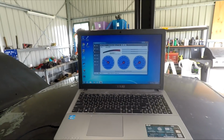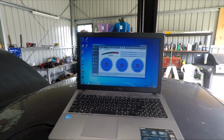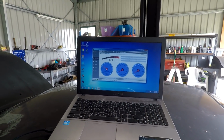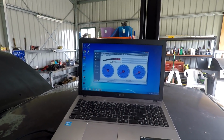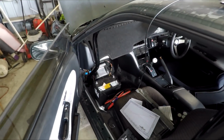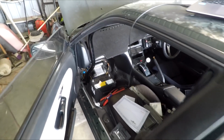Now, if you look at the 4L60 gearbox, there's two solenoids, solenoid A and B. When both solenoids are open circuit, that's third gear. So if you've got no power to the gearbox, it'll show third and third only. It's kind of like a fail-safe, so you can still get home, and you can manually select second. I'm guessing so you can take off up a hill or something like that. I don't have any power going to the gearbox, so I'm guessing that pink wire is my power wire. So let's get up on the hoist, do some continuity checks and suss it out.